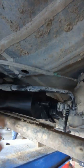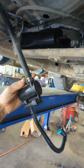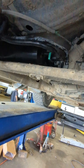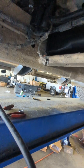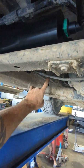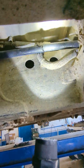I got my evap canister put back in — just push these clips back on and they lock into place. What I did with my hose before putting the vent valve back on is run it through the frame, clamp it to where I told you to cut off, and then put it back onto here and reclamp it back into your evap canister. Now this hose we're going to run along the whole frame of the truck and zip tie it down all the way into the motor compartment.